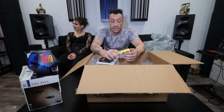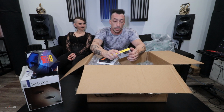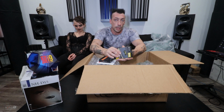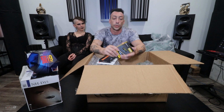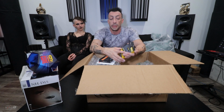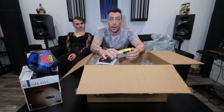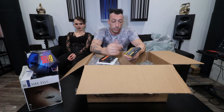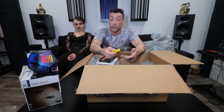I don't use many VST, of course, because I'm mixing and mastering for the most part, and your VST will use your RAM, your plugins and track count will use your CPU. So for mixing and mastering, you really need CPU power and fast hard drives and not that much RAM. For VST and production, you need more RAM.